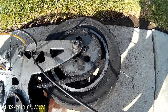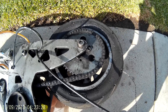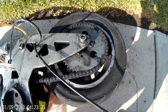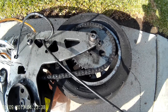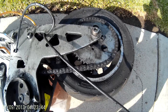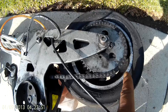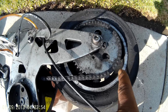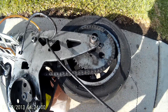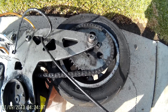I went 48-tooth rear to 11-tooth drive and I am hitting 50 miles an hour — I'm not bullshitting. If you're trying to do a budget build, there are other options like the HB head, but I went with the ESP. Keep watching the diameters — if you go lower gearing, I think you can go as low as 38 teeth in the rear on the 11-tooth drive and the transmission will still drive hard. You'd still be a bat out of hell in first gear; it's really just a top-end thing.